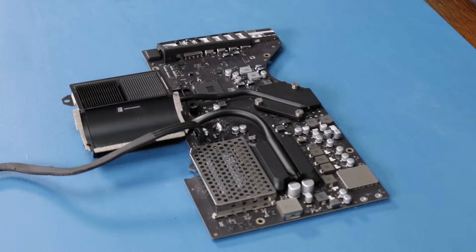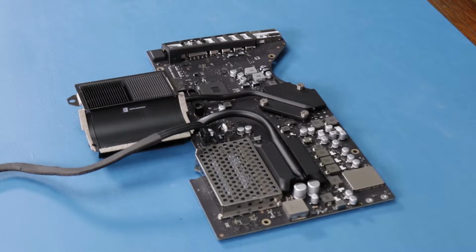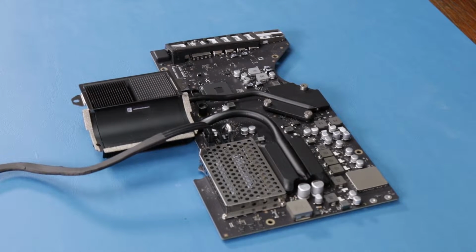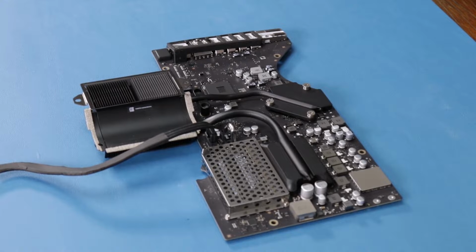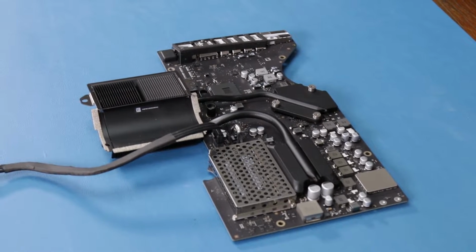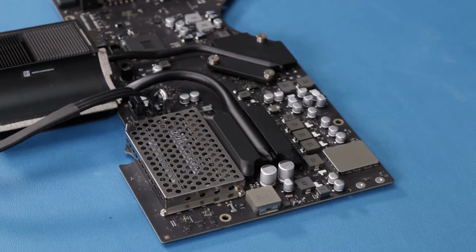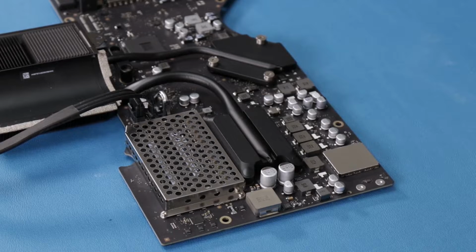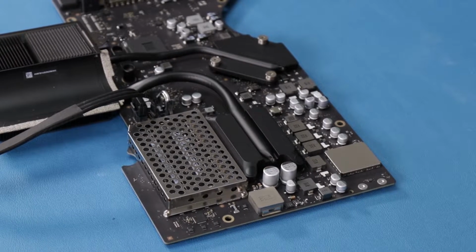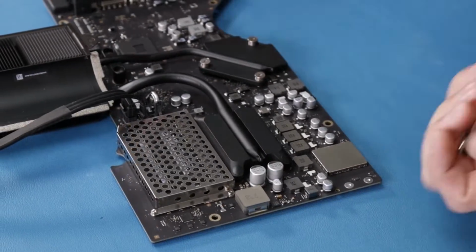Okay. So in other words, if you don't order the machine with a PCIe SSD installed, you won't have the actual hardware to later add a drive to a machine. Yes. But the 2.5-inch drive bay is upgradable either way, so you could still replace the 2.5-inch factory drive with a solid-state drive if you want. Yeah. Why did they put a cage over the memory like that? Maybe it might be a preventative measure. They started doing that with the newer Mac Minis as well. So there's a cage around those.